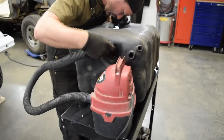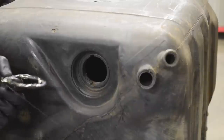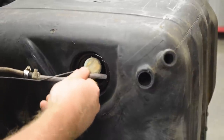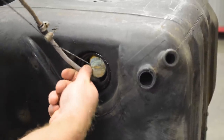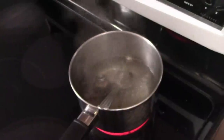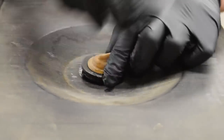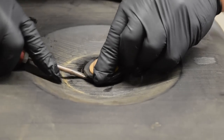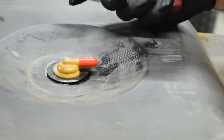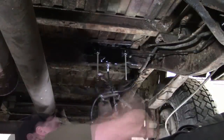With all this done, I figured it was time to finally install the tank. Of course it was filthy inside, so I vacuumed it out the best I could. Then I used a little assembly fluid to stick the sending unit O-ring in place. This stuff is very tacky but will not hurt O-rings or contaminate whatever fluid is in the system, so it is very handy for awkward installations like this. Then the broken sending unit can be installed, as it's only going to be used as a pickup for now. I tried to install the old vent valve, but was having no luck as the grommet was rock hard and the local parts store didn't have one. So I boiled it to soften it up, then lubed it with silicone grease to aid install. This is a great trick to deal with hardened seals, and if boiling it in water didn't make it soft enough, I would have boiled it in synthetic oil. I intentionally didn't try to make the tank straps an exact fit — rather they're short so they can be tightened as much as needed without bottoming.